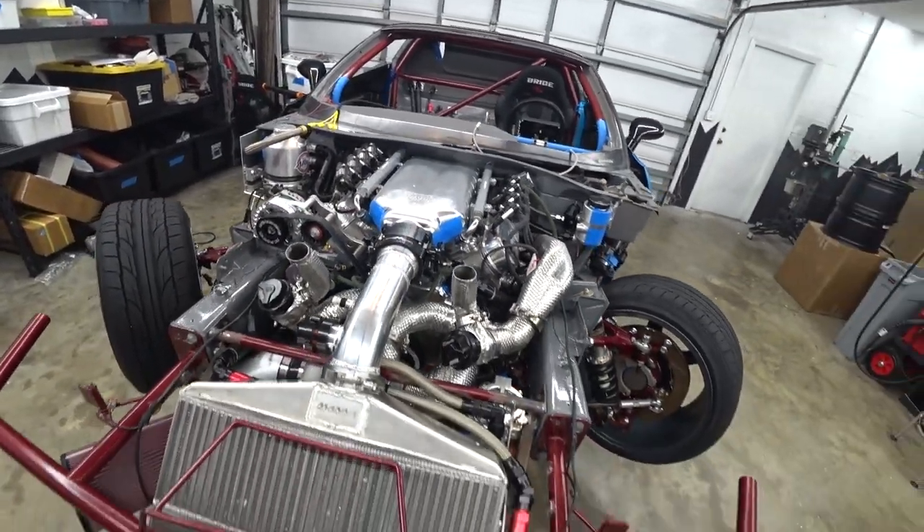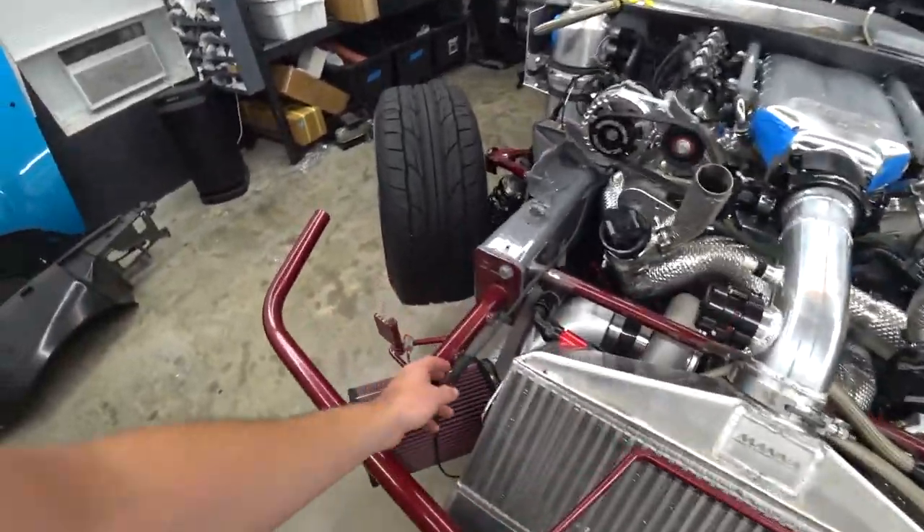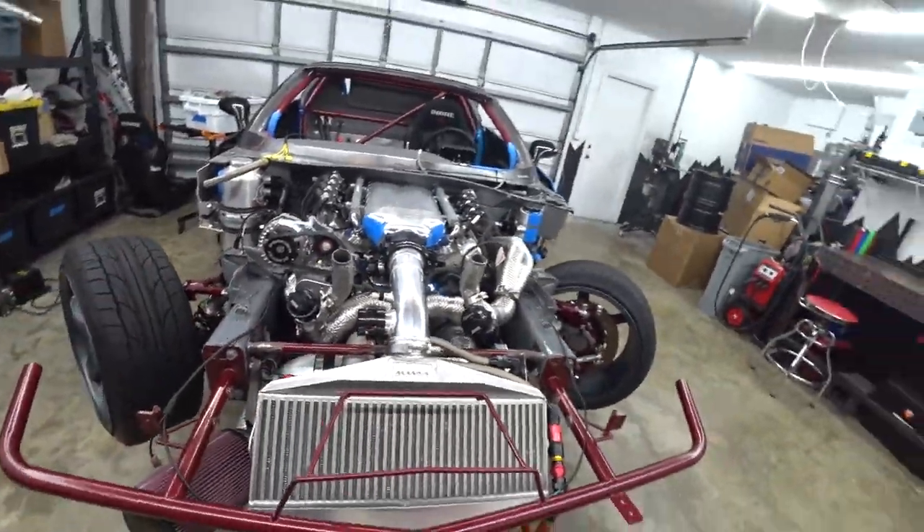Got the intake manifold back on with all 16 injectors in it — looks pretty snazzy, really happy with that. I didn't officially bolt it down because I still need to get to some of the wiring under there for the coil packs, and the threads aren't very deep on these milled heads — I just don't want to torque it down any more times than I have to. We're going to wait until we're 100% confident it's not coming back off, then bolt it all down. Pretty happy with the progress today — happy with how the wiring harness fits, happy with how it all turned out. We still have a long list and a lot left to do, but for now we are out of time. Thanks for watching, thanks for subscribing. Goodbye.